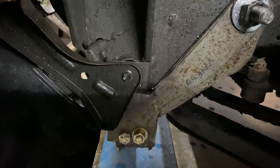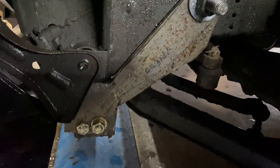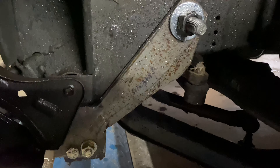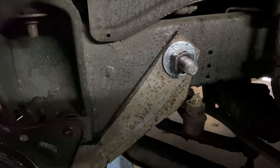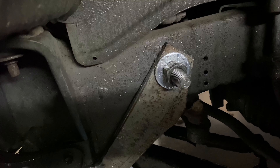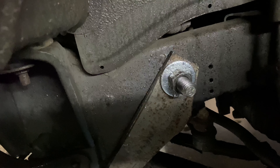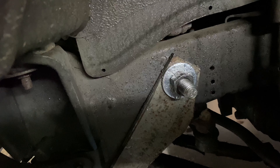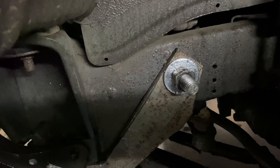The mount to the frame is a copycat of the Snow Bear mount, so I cut out a piece of 3/8 steel plate and tried to copy the size and shape. This top bolt here is an L-bolt, meaning it slides inside an L-shape. Right now that's tightened down against the inside of the frame — the bolt is like an L, so it's pulling on itself to keep it tight.